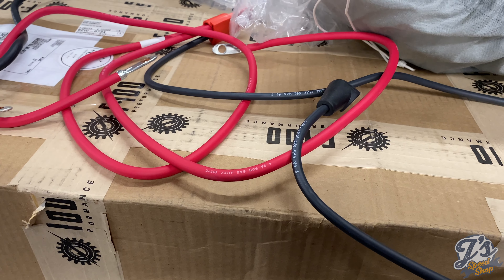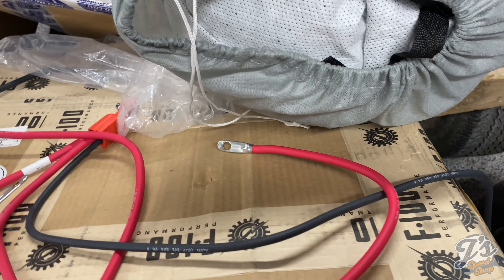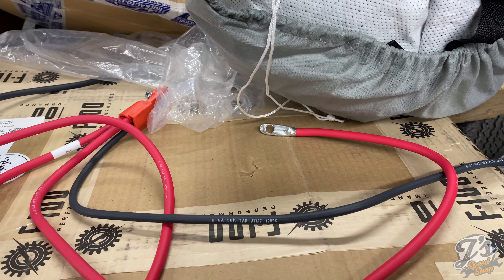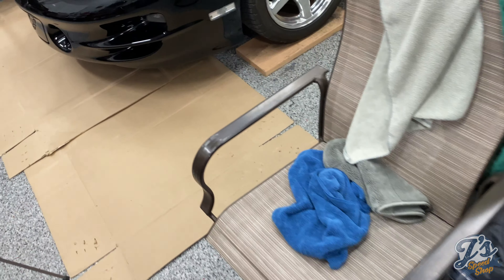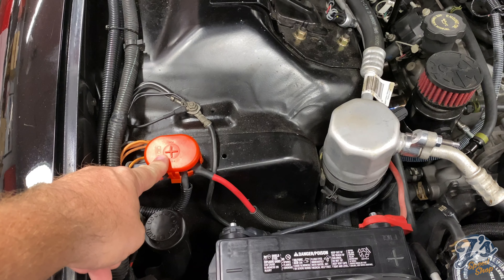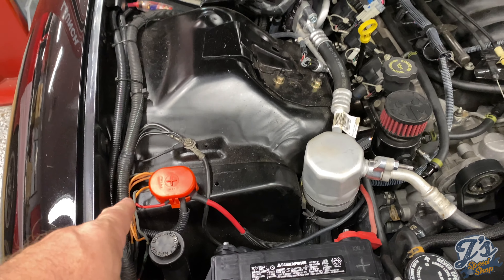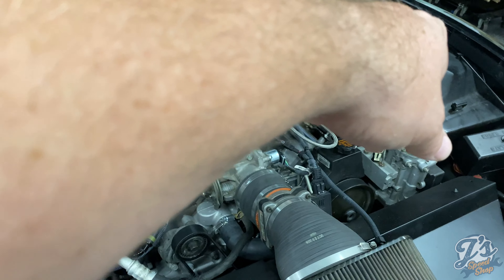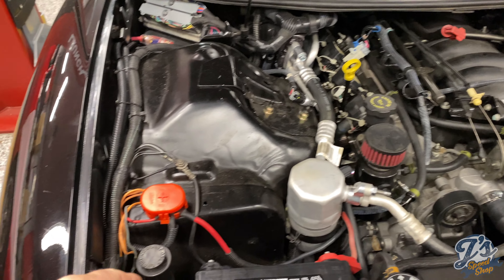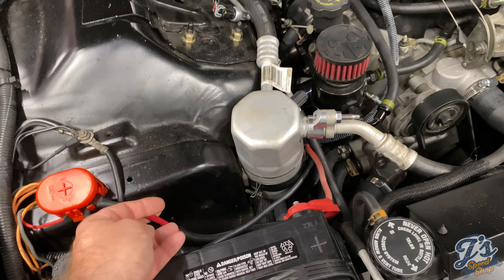I'll probably end up cutting some zip ties and things like that, but it shouldn't be too big a deal. The one wire that runs over to the accessories is too long — because on the 2000 vehicle that spot was on the driver's side wheel well, but this is a '93, so on the old install I had to cut it down and put a new end on it. We'll have to do that again. This new cable length is about perfect from the battery side, so we'll just shorten the other end the same way.